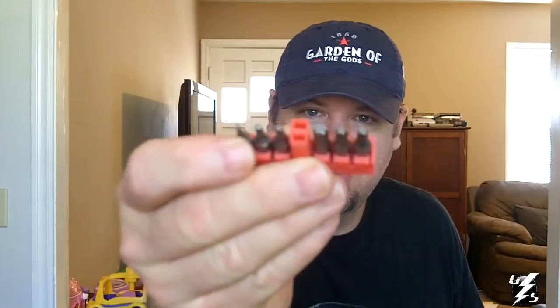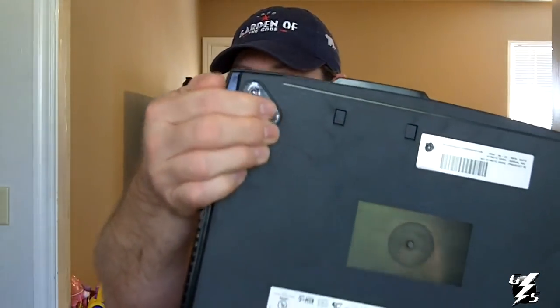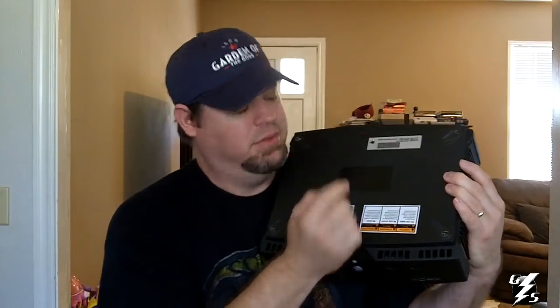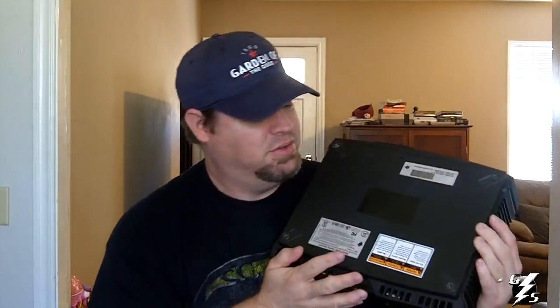So I'm going to show you what you need. You really don't need that many tools — just a screwdriver that has star bits. If you look on the bottom of your Xbox you'll see the little rubber boots; I've already taken them off. You need to peel those off because there are four screws under those, and there's also a screw under this sticker — instead of peeling the sticker off I just went through it. So there are six screws in total to take your Xbox apart.